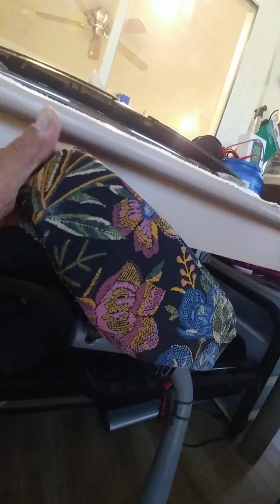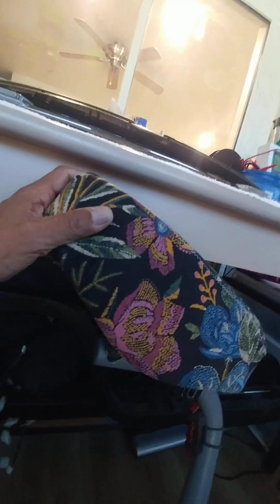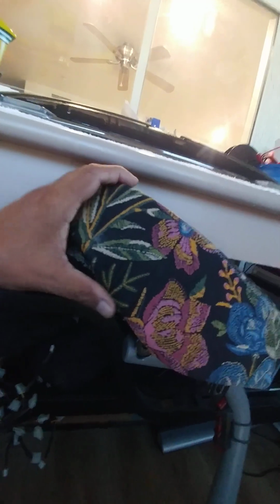The way it is attached, as we can see through here, is just attached at the bottom at that point. I have to make provisions to attach the rear section somehow. Just put a bolt right through and it'll prevent it from going up like that. Typically that's where the hole is. But if I'm on it like that, you can see how the seat is just crazy on that angle. So I'm just resting it right there, and I'm using this as my single bolt for now.